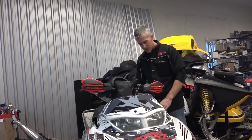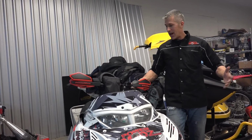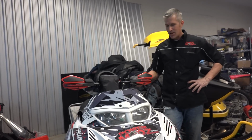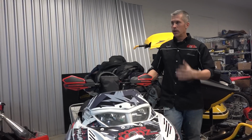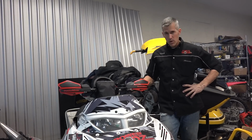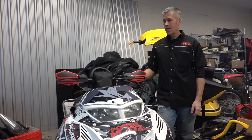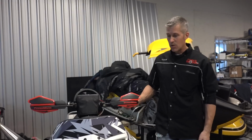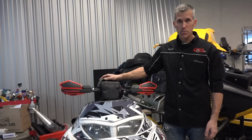Every engine builder has their own process. I've talked to a lot of these guys. You gotta do this, you gotta do that. It's pretty fun actually to talk to them and to hear all their thoughts on break-in process and just running and mixtures. You know, this is running 32-to-1 right now. I run the 827 at 24-to-1. Not sure what he wants me to run the 860 at. Everybody has their own views on synthetics, semis, and Dino oils. It's pretty fun. Anyway, I do have a great time working with these guys, especially Dan at Specialty Motorsports.